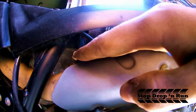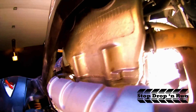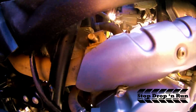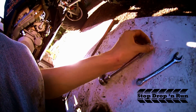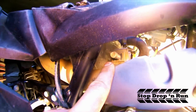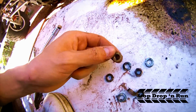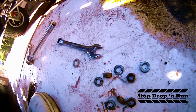There are a couple of bolts holding on this exhaust system, so we're just going to get right to it, starting with the ones up by the engine. Those nuts are off, that nut is off. I used a 15 millimeter socket for this one right there, and a half inch wrench for the ones on the engine.